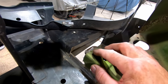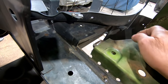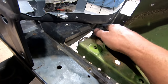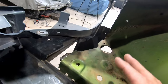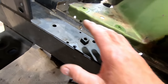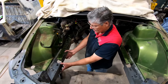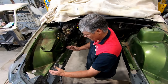On this side, this is the area where I'll have to trim it back a little bit. I want this panel to sit on top of the original, and then I can trim this across here and do a nice butt weld. Looking at the size of these welds - if this car's in a future accident and these fail catastrophically, it's no big drama because when you look at all this material here welded together everywhere, it's virtually impossible that you're going to have a problem. Even if they did fail, the car's already too far bent - it's working on the crumple zones in there anyway. Looking at the way GMH has specified to weld this rail together, it's very unlikely that would fail in an accident, but they've made the precaution that it's either side of the suspension mounting points.